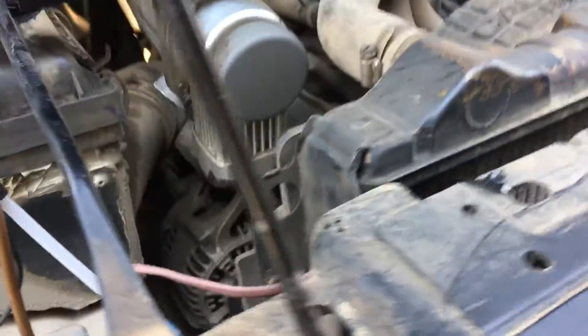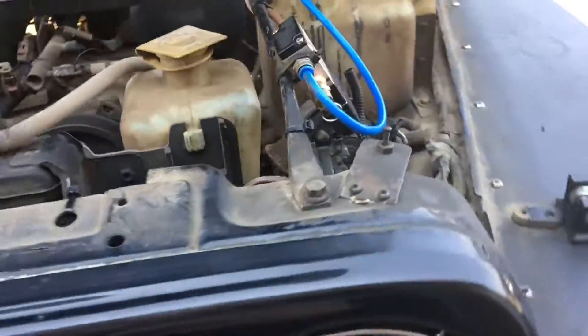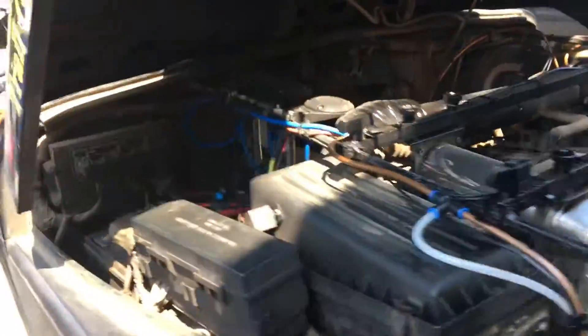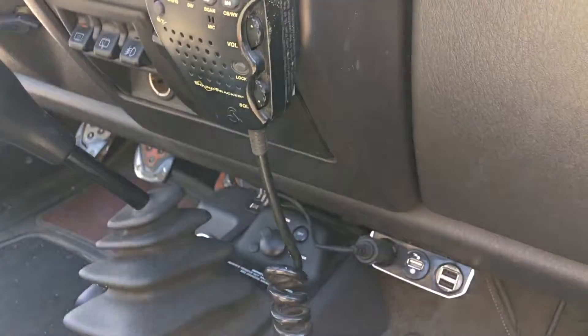From there you will get a wire and run it from the red wire that comes off your headlights, over into the other one which is tucked up inside, down along into the housing, and from there I ran that wire up under my dash and into the cigarette lighter.